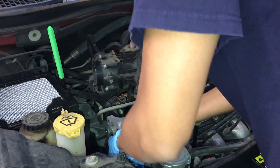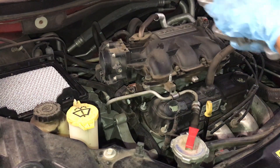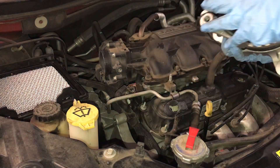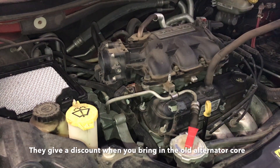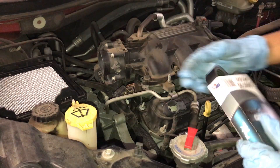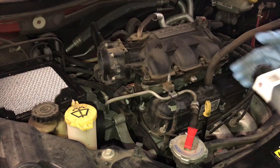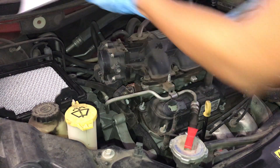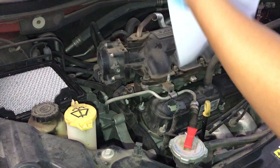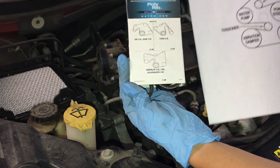It's a really tight squeeze, so you just got to grab it and wiggle and pull. After a thorough inspection of the belt, I believe the belt I have on here is good — it's in good condition, so I'm not too worried about that. I'm going to hold on to the old belt, maybe return it. You can find the belt routing diagram online and print it off, since the one on the car is for a different Chrysler model.